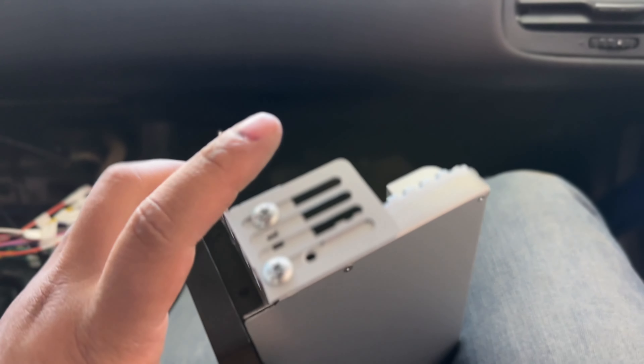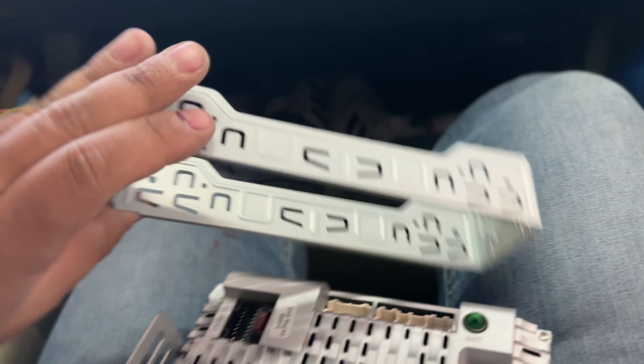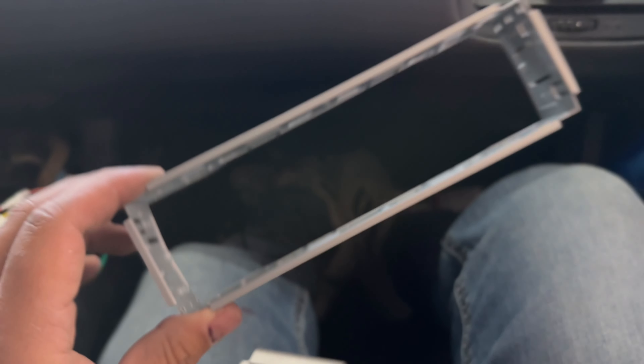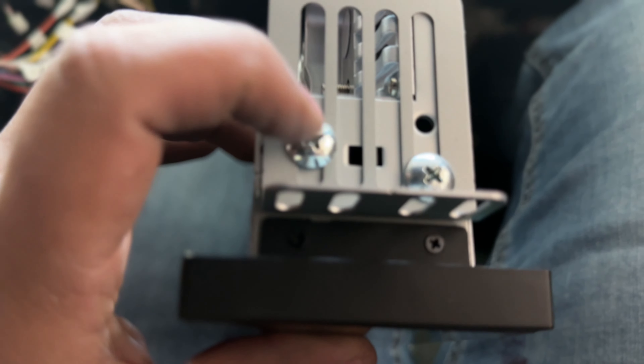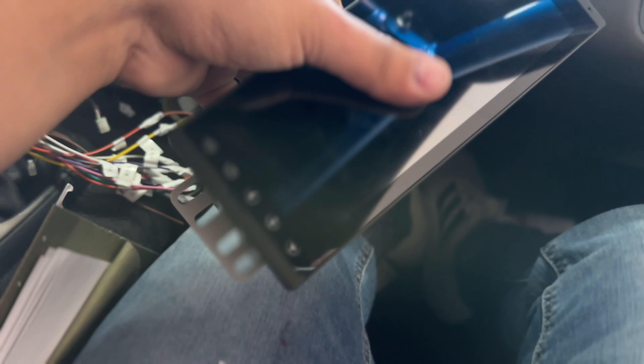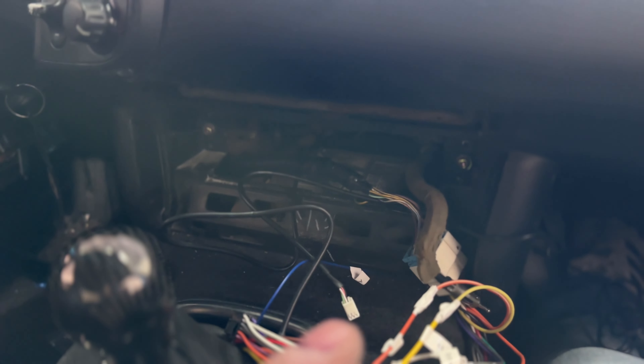So the head unit does come with these little brackets. It has one of these as well that comes over it for those radios that are pushed and clipped in. For the S2000, since it has the holes right here, you are going to need these brackets. To get access to the holes to screw these into, you actually need to take this guy completely off — we're not going to be using that. And then from there, we'll have the brackets installed to mount them to the holes right there. Let's get this put in and see how it looks.